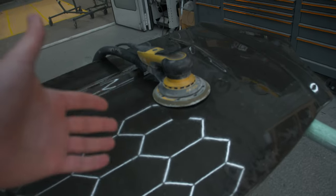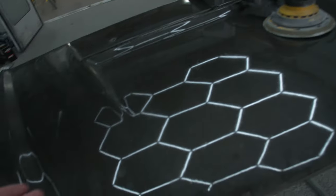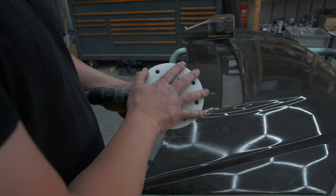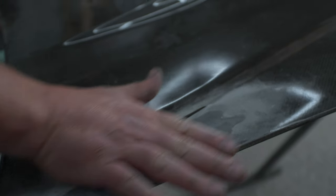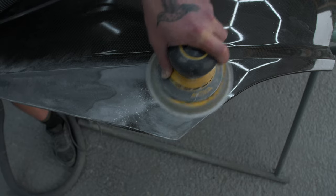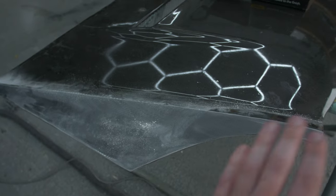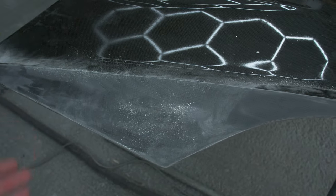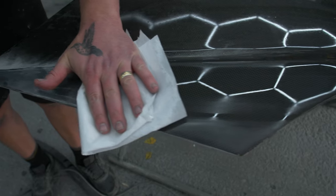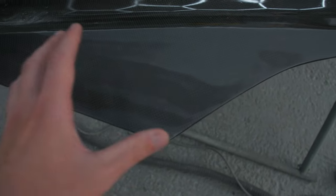Here is the bonnet — it's about to get very loud and very messy. It's just about to get hit with a 500 grit first as a test to see what happens, and then we'll see from there. This is the last time it's going to look like this. After being hit with 500 grit, I wipe it down and in theory we should be able to see the weave now that the clear has come off and know what sort of base we're working with.